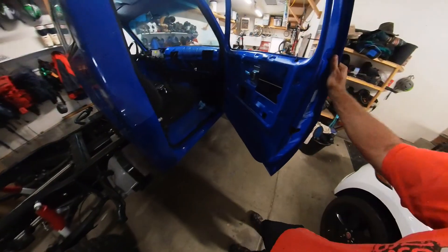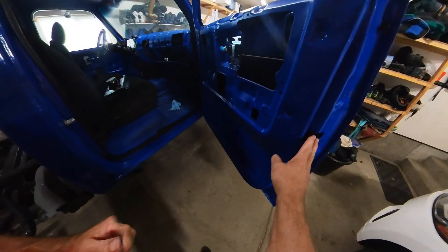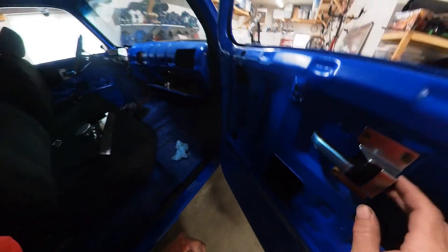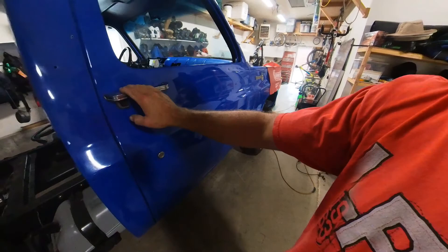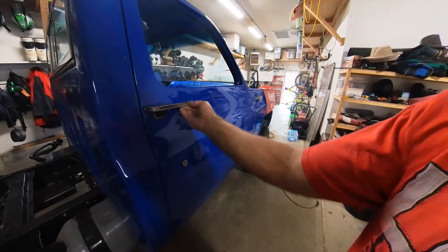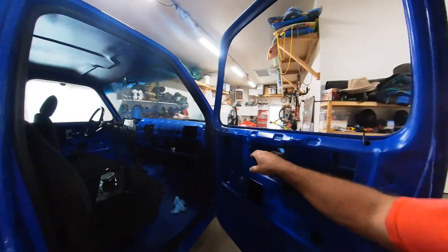Doors are mounted pretty well. There's a little bit of fine tuning left, a little bit of adjustment. All the mechanism in here is looking pretty good. We've cleaned up the latching mechanism and put a fresh coat of paint on that, lubed it up, replaced the door handles — these are brand new. This hardware has just been cleaned up and reused, same with the exterior. I can't find replacements; they're backordered everywhere, so we just took a little scotch brite and cleaned up the ones we have. They're not beautiful but they're fine. The locks are new and those are all functional, so we're happy to have all that working.